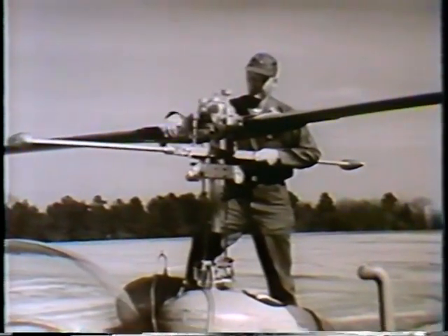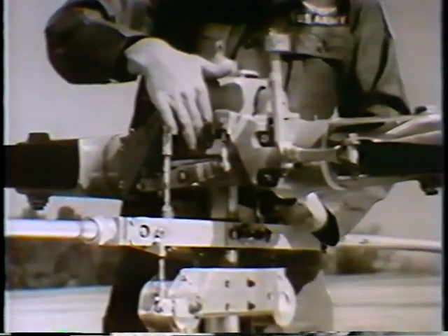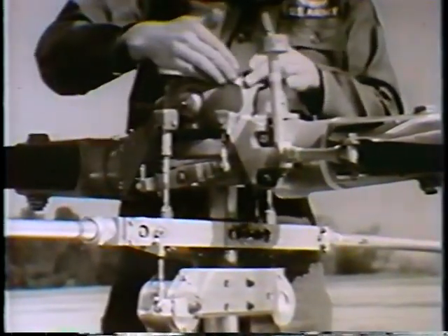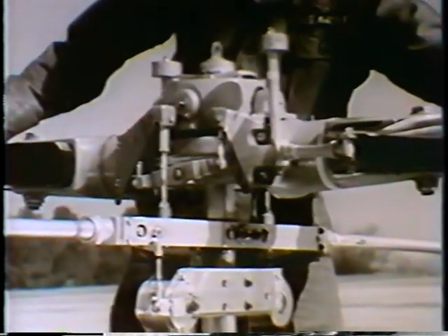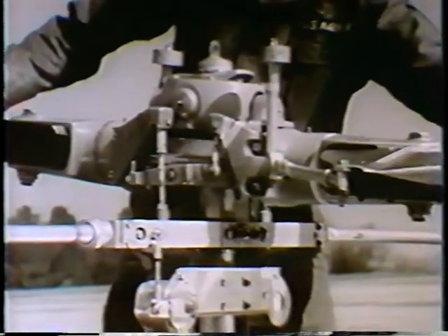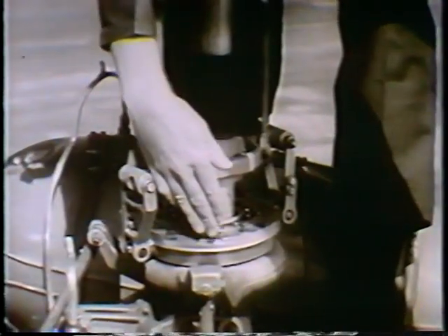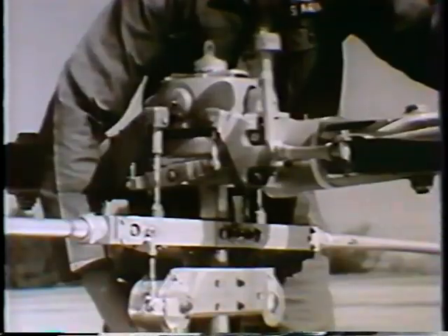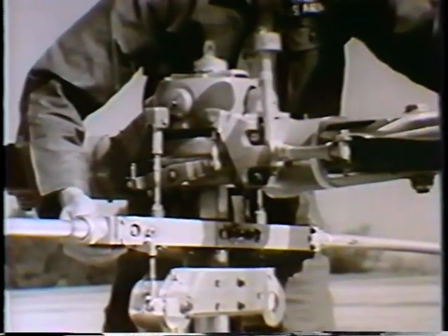This stabilizing ability of the bar can be better understood, of course, once we know exactly how the bar influences the rotor. The rotor hub is secured to the mast by a universal mount called a gimbal ring. This mount permits the rotor to be independent of the attitude of the fuselage and mast. It is subject only to the controls which come from the swashplate. However, since these controls pass through the stabilizer before continuing on to the rotor blades, the bar is given a limited amount of control over the rotor.